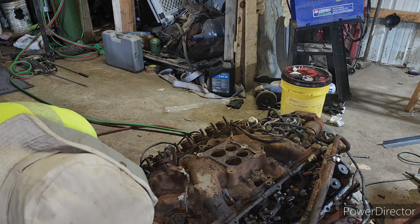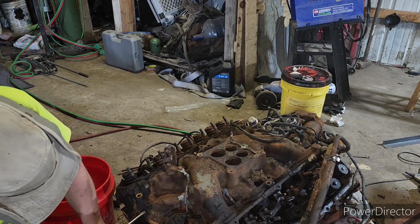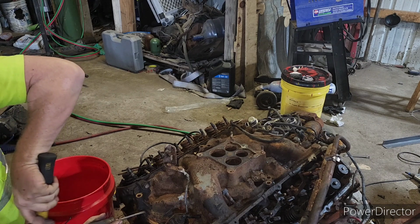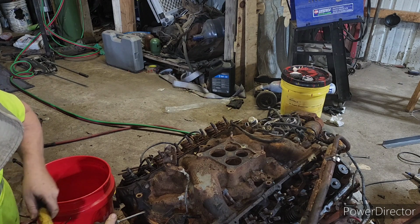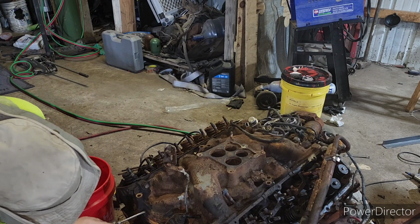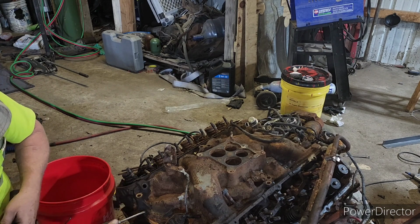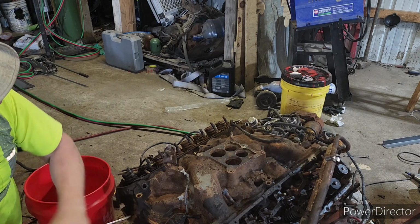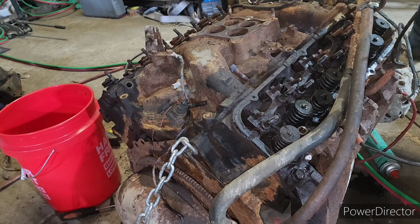let's see what's going to happen. There should be a cork gasket here, which in turn means I should be able to put a screwdriver and bang through that cork gasket and separate the intake. I'm not saying a screwdriver is going to work. It might take like a sledgehammer. Maybe. Or probably the better bet is, where did I put that chisel? Where is that chisel?